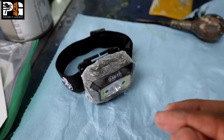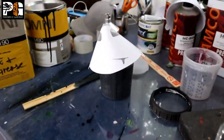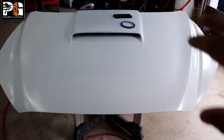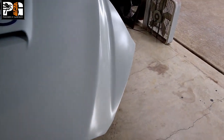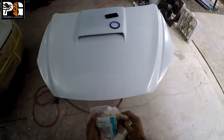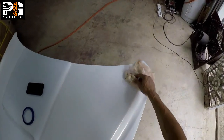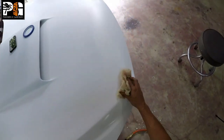Definitely check out Gun Bud if you don't have one — they're super cheap and they fit on any gun, including a gravity feed spray gun or a quick cup system. Now let's do our fine line tape and mask it up. It's pretty much dry — been sitting about 20 minutes, maybe another 5-10 minutes and we can start. Make sure you tack it first to get any overspray off, because if there's dust under the fine line tape it will not stick.